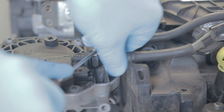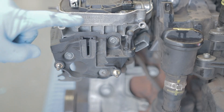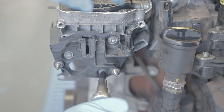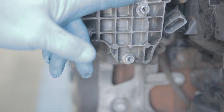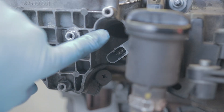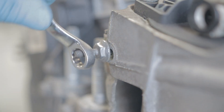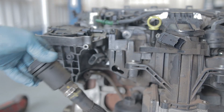Pull that tab up, press the clip down and the fuel pipe will pull out. Two 10mm nuts here and you can remove this cover out the way. There are three Torx 30 screws holding another plastic piece of trim to this fuel filter housing - you're going to have to remove this piece of plastic. The nuts that hold the whole housing onto the engine block are behind this, then that should just pull off. Use a magnetic 10mm socket as it helps - you've got one nut under here that's not easy to get to, another nut at the top and a little bolt at the bottom which both have to be removed. There's also a 13mm nut on a stud to the side of the housing - you haven't got to take that out, just loosen it a little bit and the housing will come off. Your oil filler you can just unclip and push out to one side.